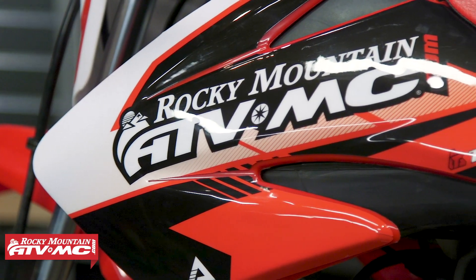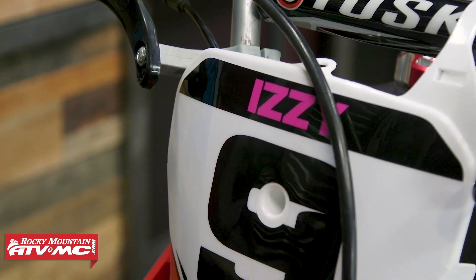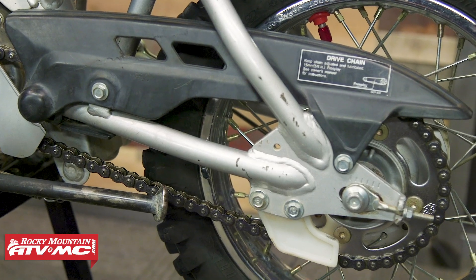Those are just some of the things to look out for. When we picked up this 70 it was in pretty good condition, but we still wanted to add some parts and freshen everything up. First things first, we put the QA Parts plastic kit on here. Once that was installed we did the ATK graphics kit, which just gives a customized look for that youth rider — they absolutely love graphics on their bikes. Also the chain and sprocket were pretty worn out so we replaced those with the Primary Drive chain and sprocket. A lot of riders with these smaller bikes like to actually gear them down, so we went from a 15-tooth front sprocket down to a 14, which just helps gear the bike down.